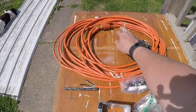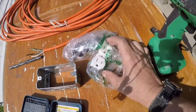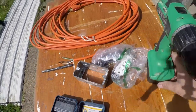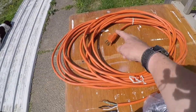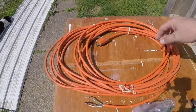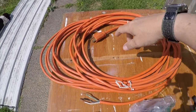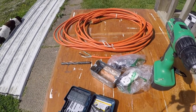Here's what I'm going to do. I've got an old extension cord with just one end — just the male end — which is exactly what I need. I've got a couple of 110 sockets, an electrical box, and a drill. I'm going to put in enough of this cord to run to one of these boxes inside the van, right where the refrigerator cord is. I'll leave about a foot of this hanging out the bottom of the van so I can tie it up easily and it will not be seen, and then I can just drop it down and plug in an extension cord to whatever I need.